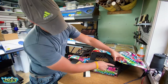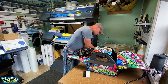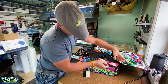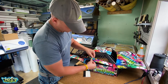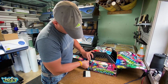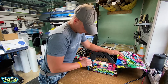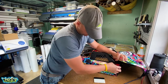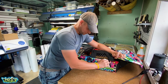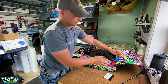This piece is done. Moving on to this next piece — it's going to be a little more challenging because we have to get up in here. This is going to go up here — laying it and getting it somewhat in place, then restarting from back here. Giving it a little pull. Maintaining my 1/16th inch gap. I squeegee it down. I don't like how wide my gap is there so I pull it up quick, tighten the gap, make sure it adheres down — and we're done. This will come down and cover that.